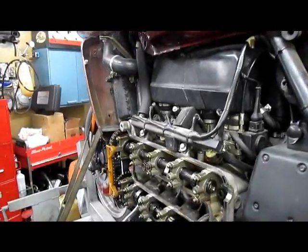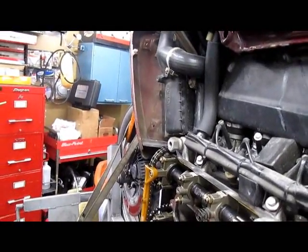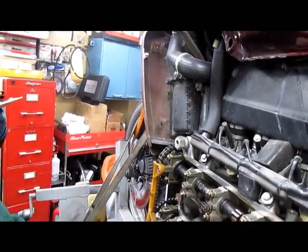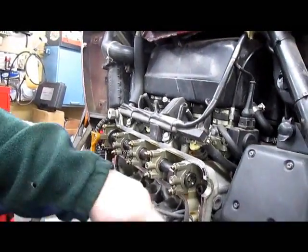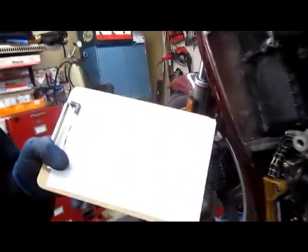See how incredibly simple this is. It's too bad the adjustment wasn't this simple. Our next up is going to be 3 intake. Help if I grab the right one. There we go. 15 is a go. Our exhaust is going to be number 4. 25 is a go. Does that not complete our... That's it. We are done. Everything checked off.